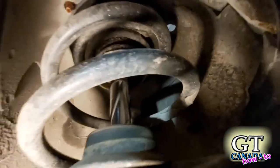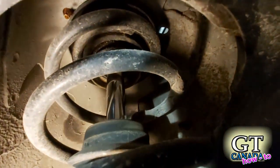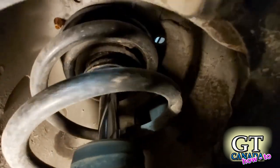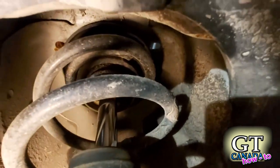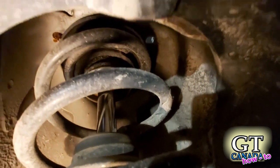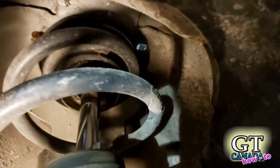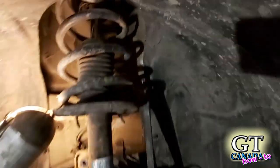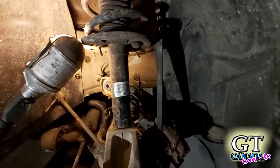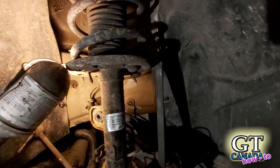I've also pulled out the steering link so that I can move this whole assembly. And one thing I can notice now — if you look up in there, there's a bearing up there. You hear that rattling sound? That's the bearing binding up. Part of the problem I was having was during lane changes I could feel the wheel binding — so that's where the problem was happening. I'm going to replace the whole thing because the strut is a pain anyway, and the ones I bought came with a new bearing on the top as a complete assembly. Might as well do it all while you're there.